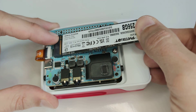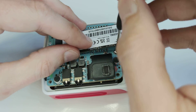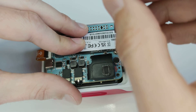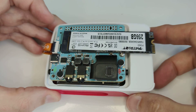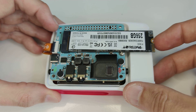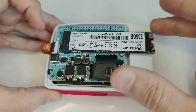Be sure the device is off and not plugged in. Insert the drive like this. If you chose to use a long drive like this one, you will need to use a screw located on the side to firmly attach your device. To enable the NVMe drive in your system, please follow the other tutorial — this tutorial covers only the physical aspect.